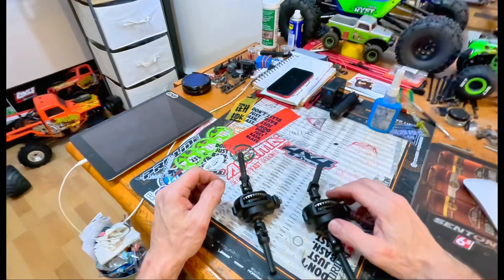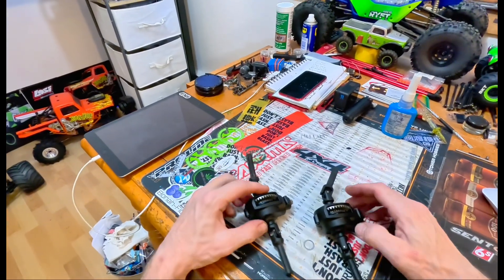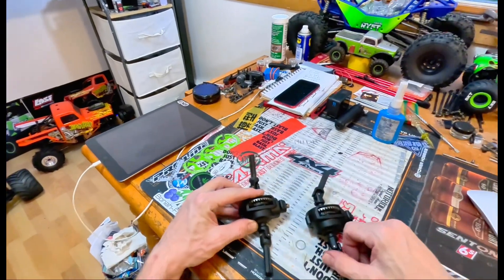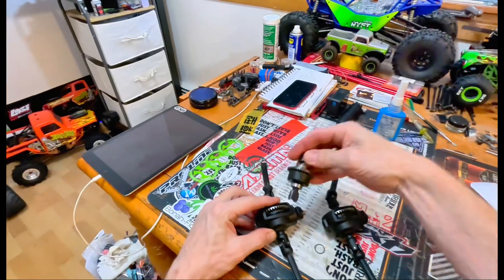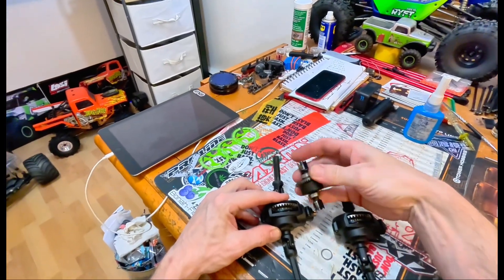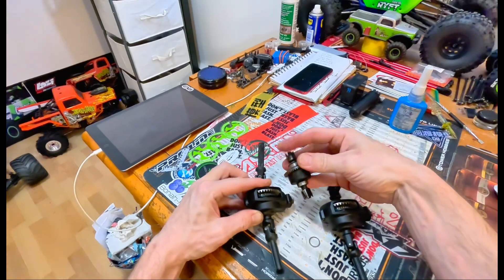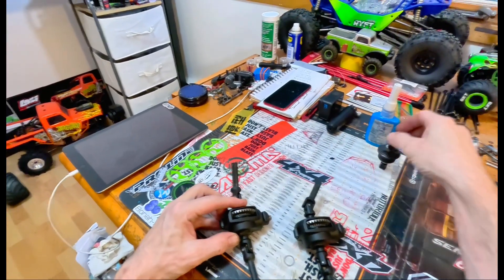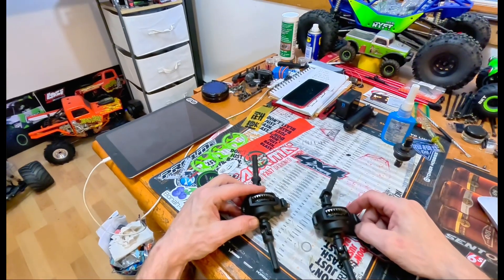Don't wait for it to try to heal up. There's a lot of friction, a lot of heat. These gears are big — they're not just going to wear in like normal 6s ones will. The teeth are not even close on 6s. Don't expect them to wear in, guys. Crack them open, pull the shim. If need be, you can add it back in later.